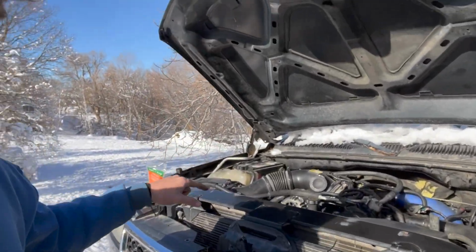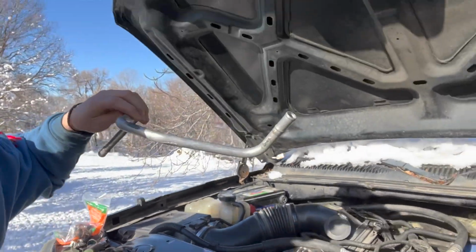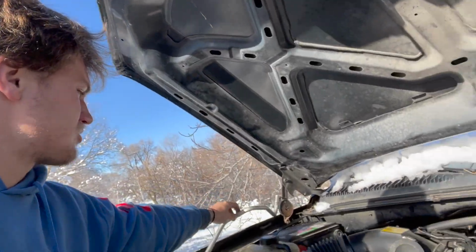Anyways, got a coolant leak down this pipe on this hard line, so swap that out. It's like cutting out when we're driving it a little bit. So I was gonna swap the fuel filter, but I'm just gonna delete it. Seems easier. Those things cause more problems than they do because I got a lift pump on it. What else? Coolant, fuel filter, and then we'll figure out what we're doing with the exhaust today. So get that far, and then keep chasing problems and troubleshooting it. See if we can make this thing run with this piece of turd motor in it. So let's get to it.